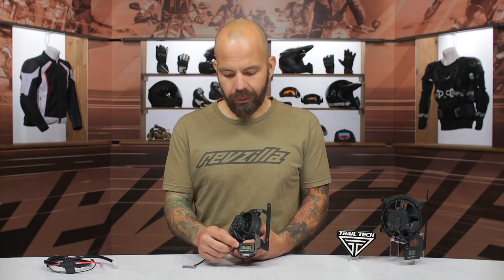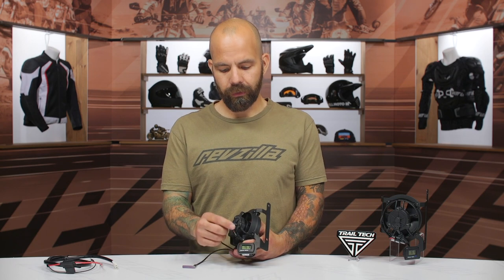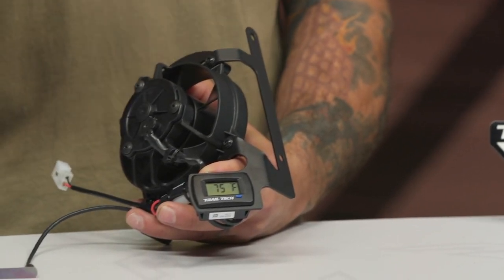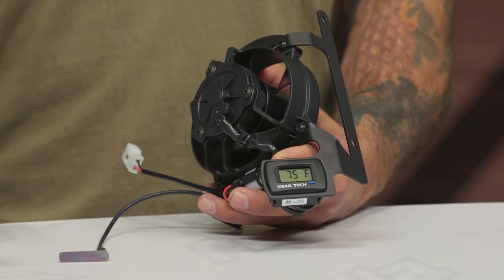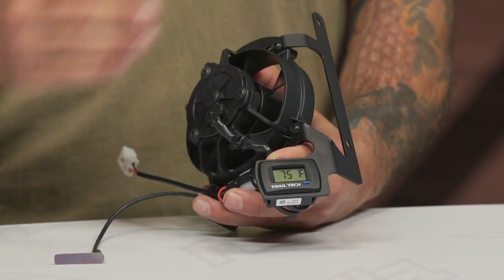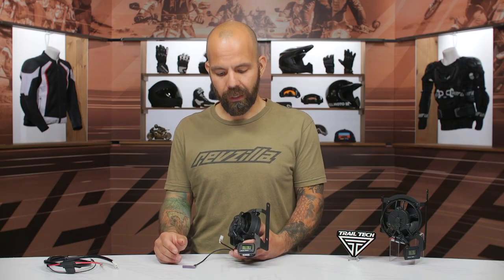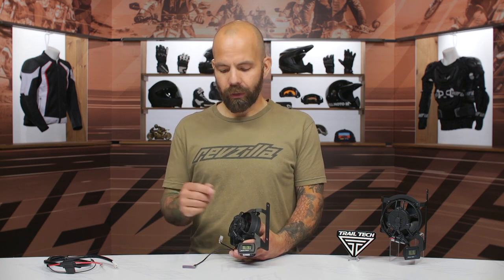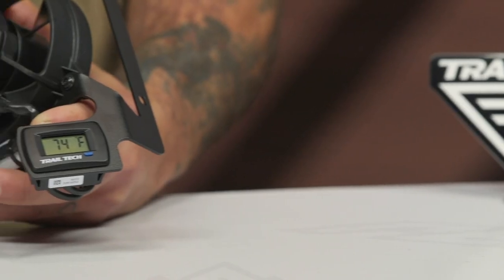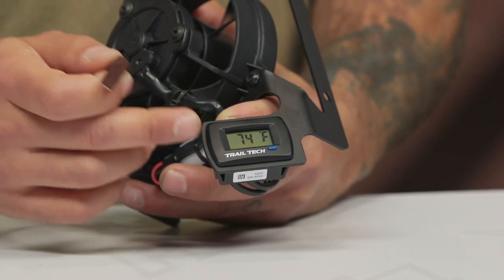As you can see here, it's a very clear, easy-to-use thermostat that allows you to adjust the temperature range between 150 and 200 degrees Fahrenheit. For folks not in the U.S., you can put it in Celsius mode, so no need to worry about converting units of measurement. A lot of folks usually run their bikes around 185 degrees — that's pretty common. So once your bike gets to 185, this sensor will read that, click the fan on until the bike cools off, and then it will go off automatically when the temperature comes down.